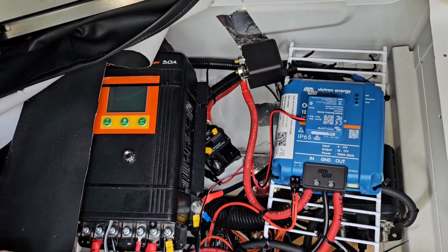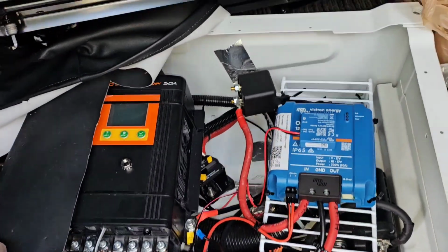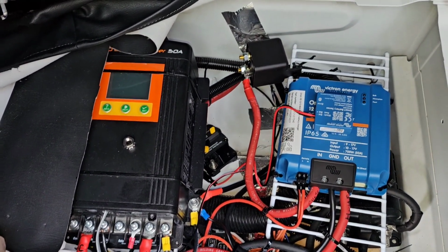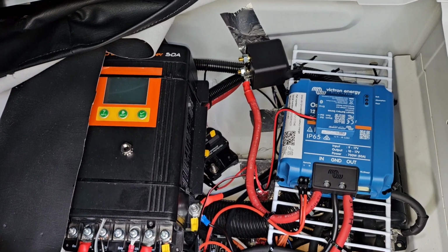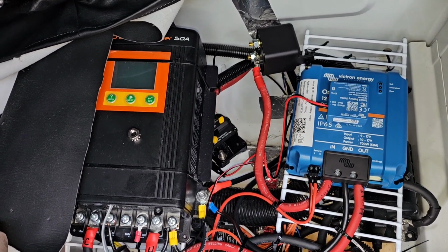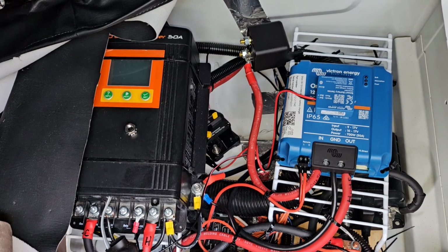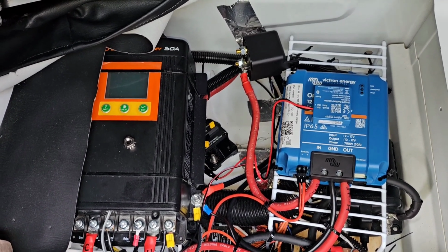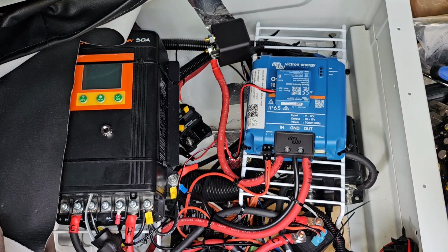Then that way, I also have a trickle charger charging my chassis battery. I actually have an old trickle start that I had from my original lead acid batteries. So when the trickle starts charging your chassis battery from the house battery charging system, then these DC-to-DC chargers think the engine is running because they see that increased voltage on the chassis battery wire. So then they start up and they think the engine's running, so they're going to start charging the house battery, and you create this loop of charging that basically runs both your chassis battery and house batteries down. So you always want to have an ignition controlled isolator relay with these DC-to-DC charger installations on the chassis battery connection, so it's isolated or basically turned off when the ignition is off.